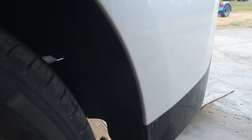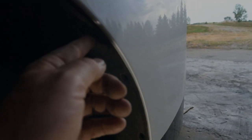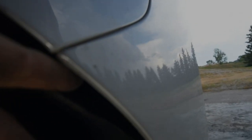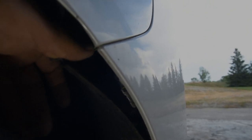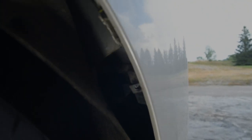There are T15s here, here, here — I think there's only three on the other side. There's a bolt here and probably another one right here that I've got to get to. After you take these T15s out, you're going to pull this fender back. Right where my finger is, there's a seven millimeter bolt — actually a 10mm — and that bolt comes out, which will help you pop this rear bumper off. You've got to do the same thing on the other side.